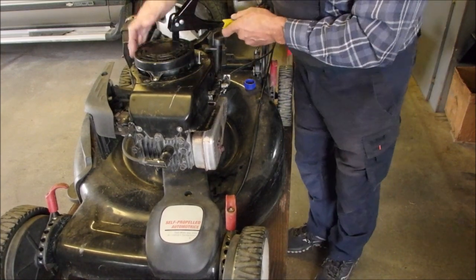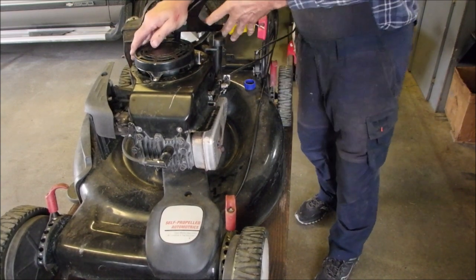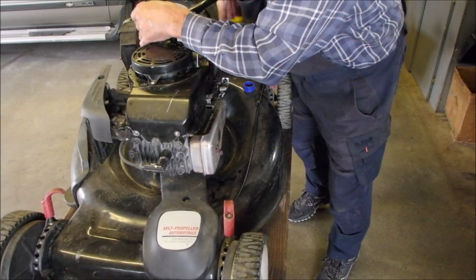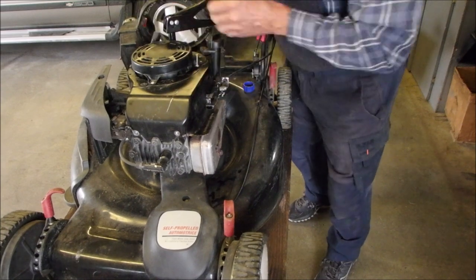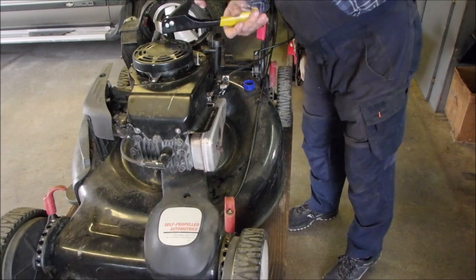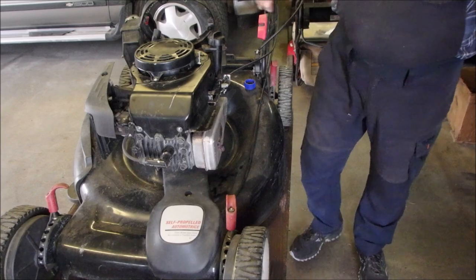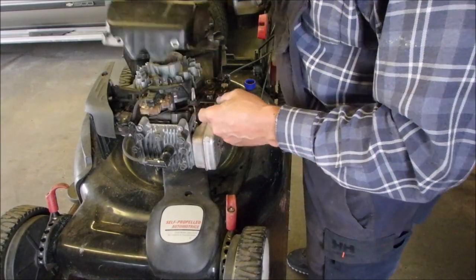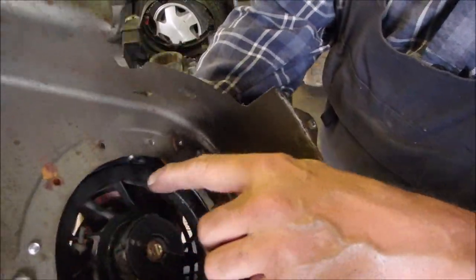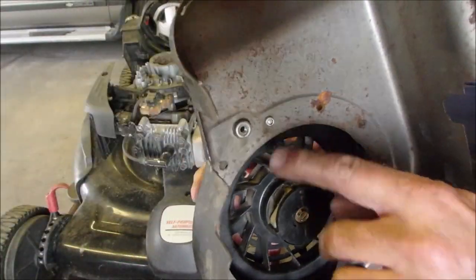When you start a rivet, you have to push pretty hard on the rivet gun because you want the rivet to expand on the other side, right? And it's usually a double-hander for me. Okay, before we put too many more in, let's have a look. They look just like the old ones did. Right there.